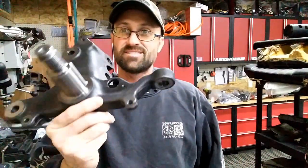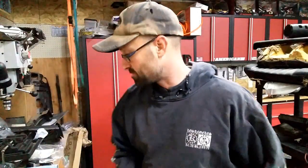Look how these things came out — hard to believe those were all rusty. To assemble the spindles back together, I need to put the dust covers back on. Rather than doing rivnuts or rivets, I'm just going to use some quarter-by-20, two-inch long screws — the same ones I used on the wide body — cut down to about three-quarters of an inch or less. I'm also using nylock nuts from the local hardware store, about a buck for a couple. Six total, three per side, so the dust covers can go on and easily come back off.